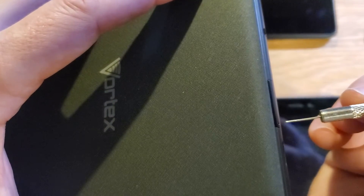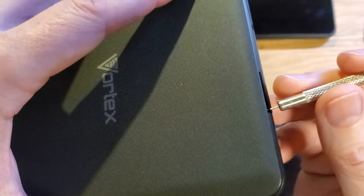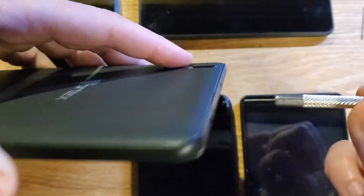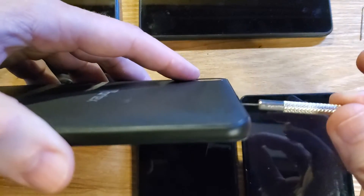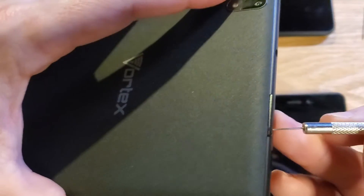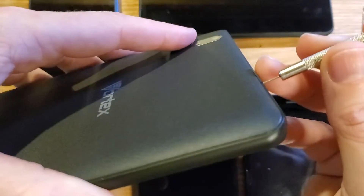It's all easy and small motions. If your tool is sinking all the way in, just stop for a second and change the angle just a little bit. If I'm holding the tablet flat and I stick the tool in straight like this, I'm going to miss the switch — I bypassed the switch. What you have to do is come in at about a 45 degree angle to find that switch.